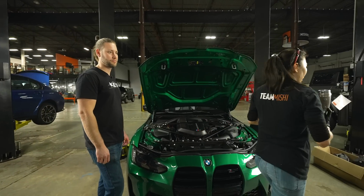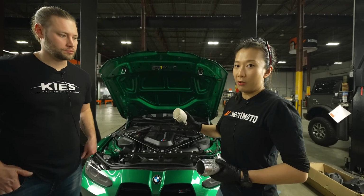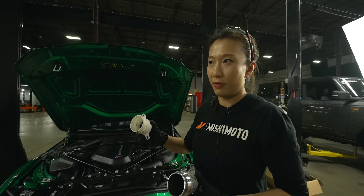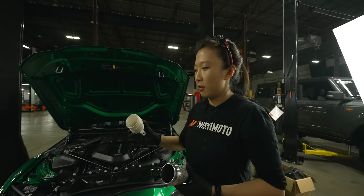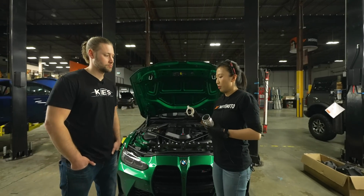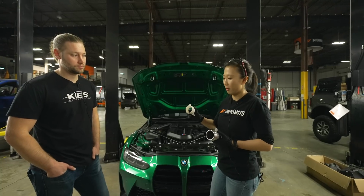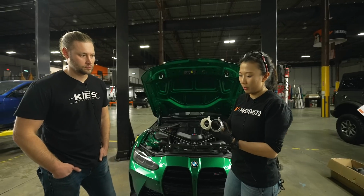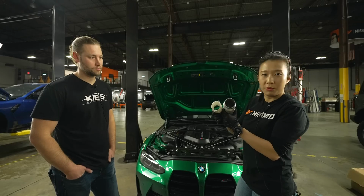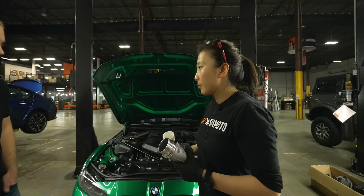Yeah, let me check if I have the prototype here. This is our prototype. We have an aluminum cast turbo snout as a final product, but this is a nylon SLS prototype. SLS stands for Selective Laser Sintering. This is made out of nylon powder. It can withstand high heat and is also very strong. So we were able to use this plastic part, a prototype, to finish over 1,000-mile testing on our vehicle. So you can see when you line up the turbo inlet, this turbo snout provides you with a bigger inlet and a smoother angle to adapt to your intake tube and conical air funnel. Yep, that's it. That's great.